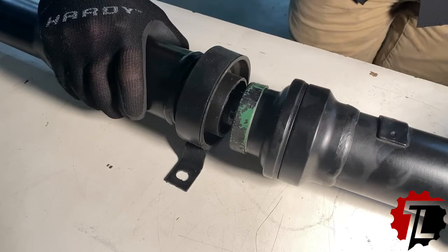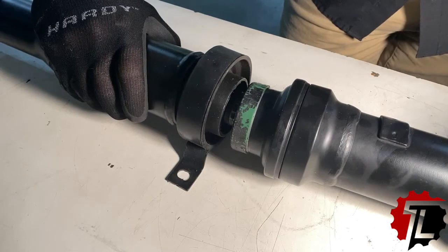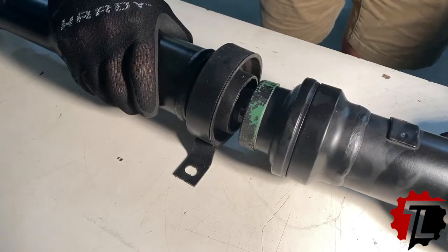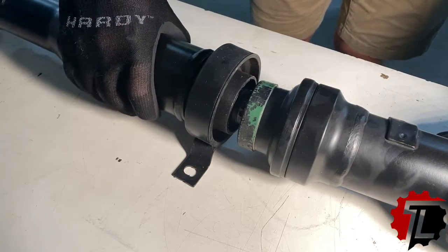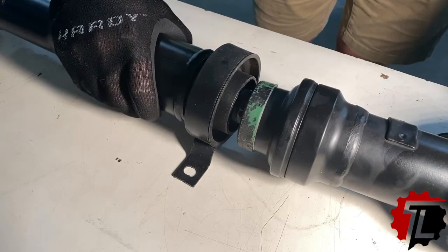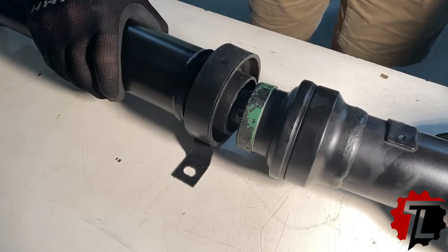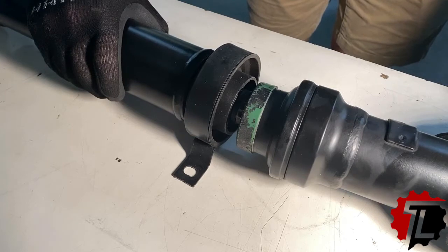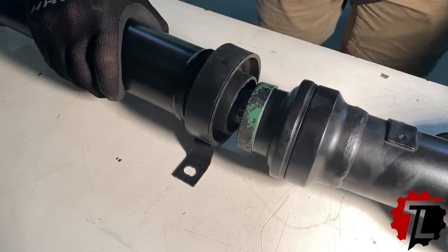So we've done the typical things on a test drive. Whenever you have a vibration, you want to figure out if the vibration is related to road speed, if it's related to the gear that the vehicle is in, or two or four wheel drive. During a test drive, we isolated the concern and found that we could get the vehicle to where it was making the noise and the vibration. We could shift it into neutral, and as long as the road speed stayed constant, the vibration remained. As soon as the road speed dropped below the frequency threshold, the vibration went away.